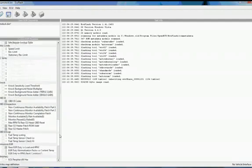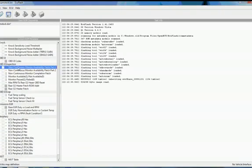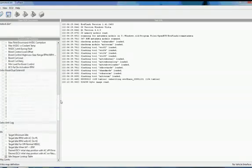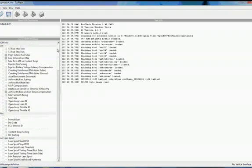We also have things like the rev limit and other things that I've added that you probably don't have, particularly OBD2 inspection tables, etc. This is kind of the beauty of EcuFlash, in that the more that people discover about how the intricacies of the Evo ECU work, the more tables that can be added and defined into EcuFlash and allow you to edit more.